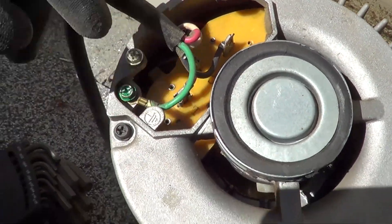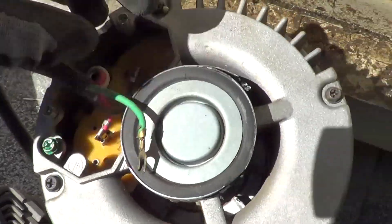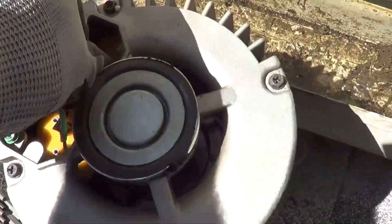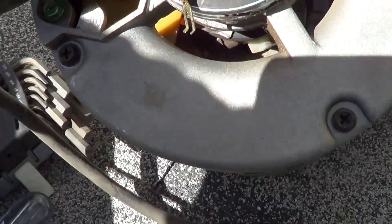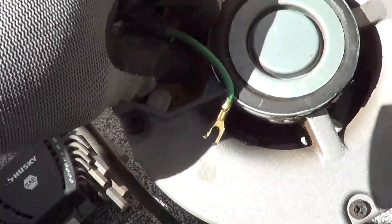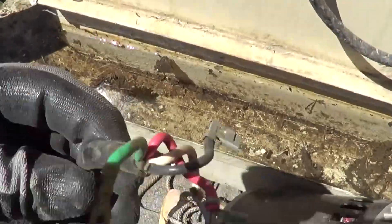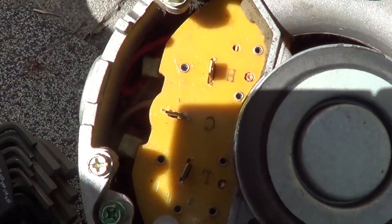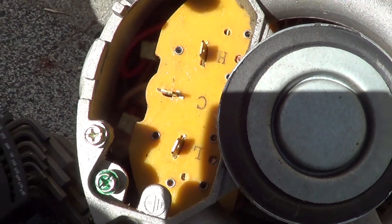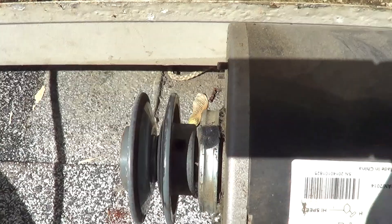With the motor on our lap, we've loosened the screw so we can pull the plug to the side. These spades just pull right off. We're going to save this plug to use for the new motor, so set it aside. Keep track — red is low and black is high, but not always, so triple-check that.